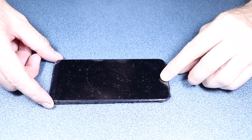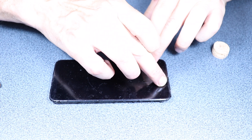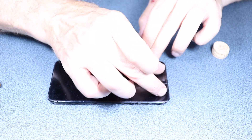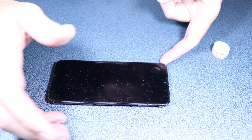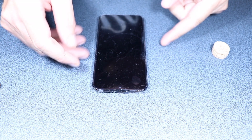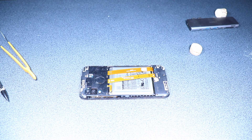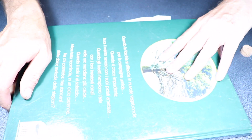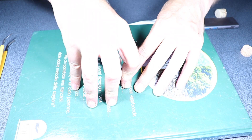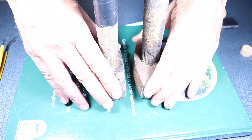Gently press the LCD into the frame, and don't worry if there's some glue that comes out of the edges — when it dries up it's gonna look much better and you will be able to remove it with no difficulty. I could only find this book here, so I'm just gonna put this on top and then put my two hammers here — hopefully this will do.